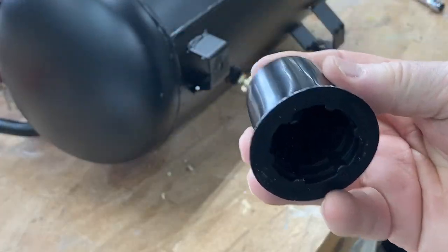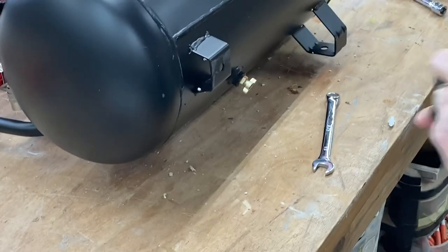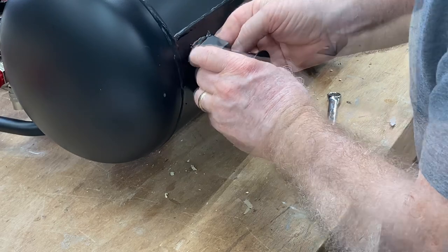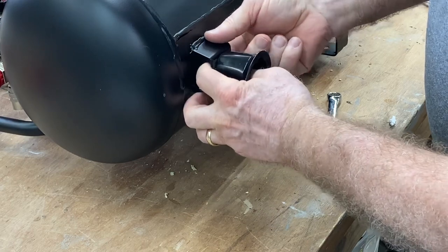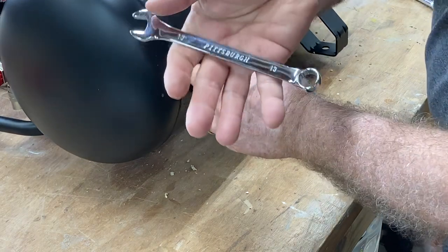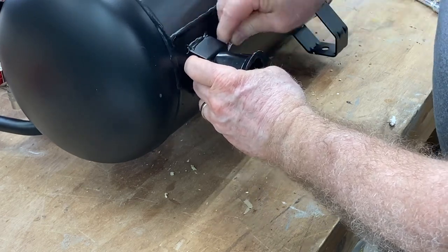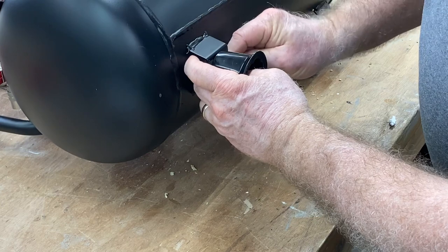There's a little rubber boot that goes on the front, and you have the nut and bolt to put it in. That's real simple — you just drop it in, slip it into the hole, and tighten it. I just used two fingers to hand tighten it, and once it's hand tightened, grab a wrench. This is a 13 millimeter, and that's all you need — you don't need anything else to hold that bolt in place while you tighten the nut. It is just a little bit of a tight quarter, but it's really not bad.